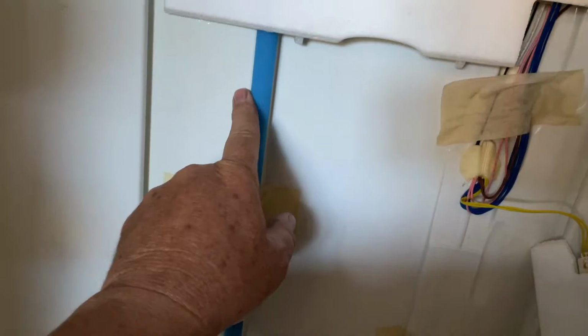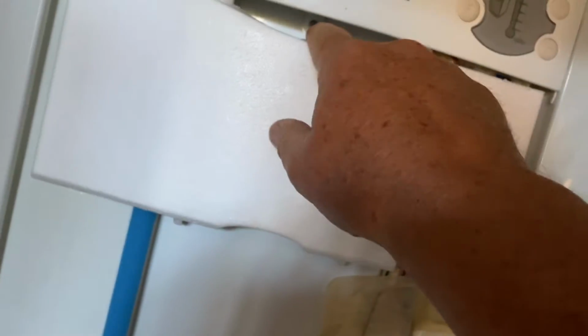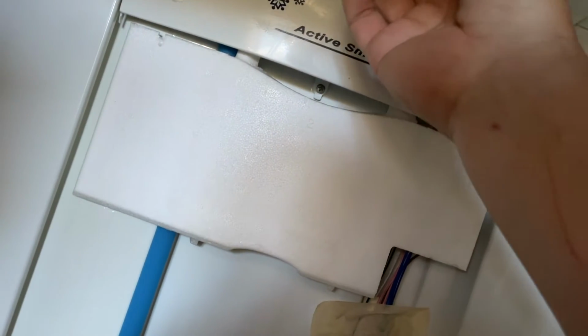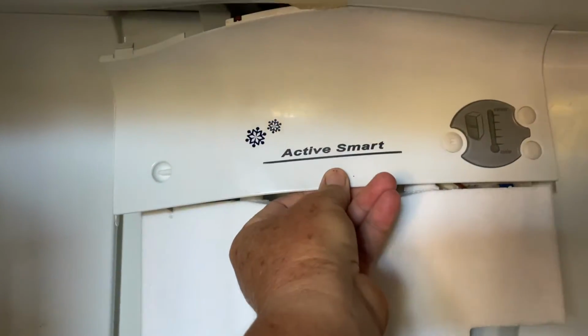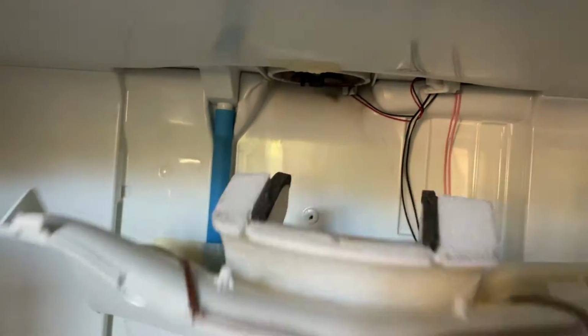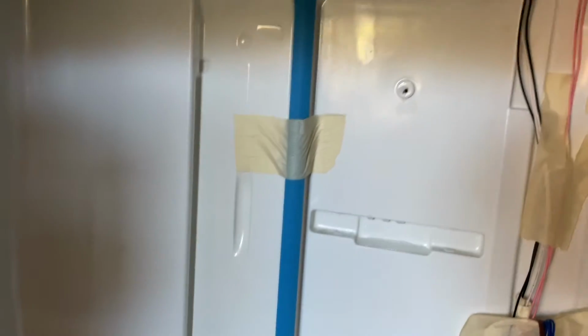And most importantly, look at that. That's going to be our drain tube, which goes down to that one at the bottom. So we've finally accessed that. There's a screw up here to take this panel off. So we'll undo this screw and go that one extra level and see if we can find the top of that drain pipe. Screw, and straight away this panel here is able to drop down. And apart from the wires, the whole thing comes out. There's an awful lot of foam insulation. So we've got some bits and pieces here. But as I've said, we've now got access to this drain pipe.